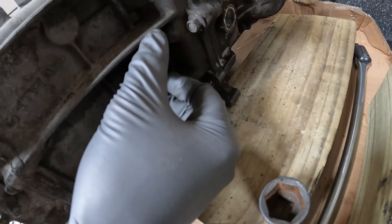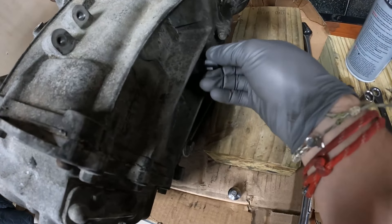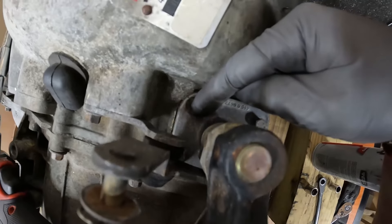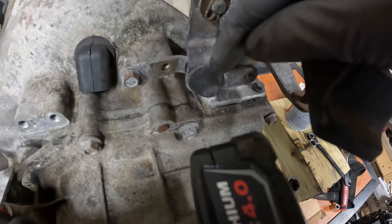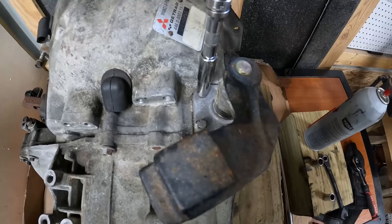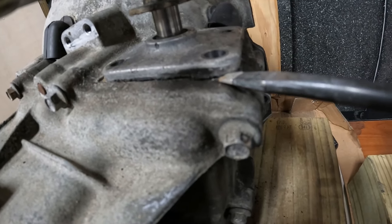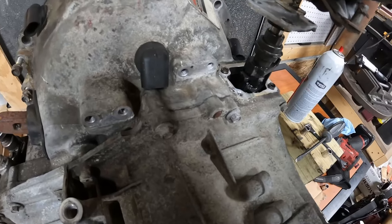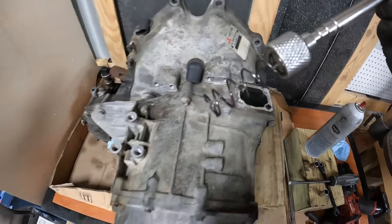I'm also going to get some sensors out of the way - there's one sensor right here, a 24 millimeter bolt with a hex part on the bottom you can get with a deep socket. We need to get to four shift bolts right up here that hold the base plate - two here and two on the other side. The last one is hidden right underneath one of the shifter linkage pieces, so we need to get those two bolts out of the way to access it. Once we have that last corner bolt removed, we take this and give it a nice good pop. There's a little gap underneath, so we can get in with a flat head - be super careful because you do not want to break this.